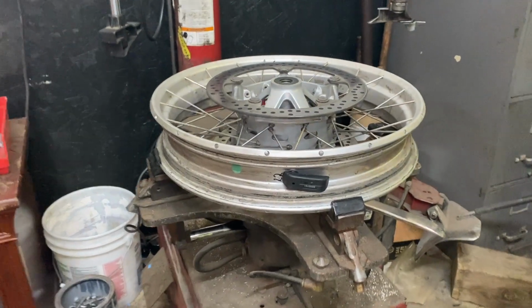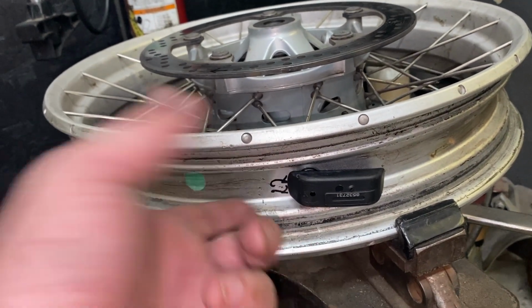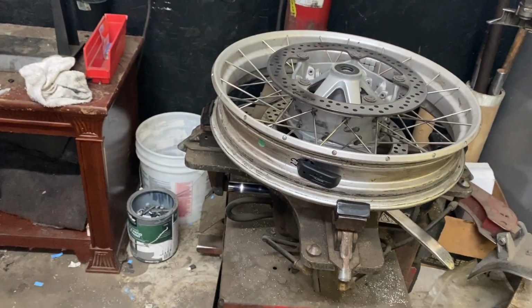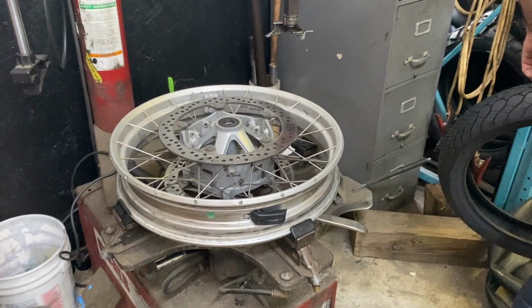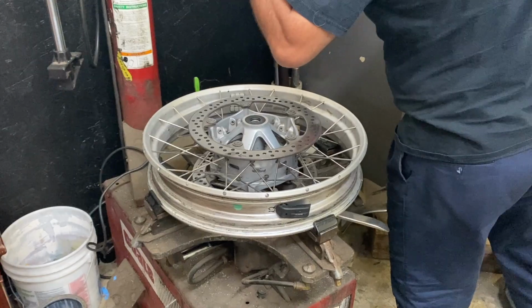So I don't know, you might not know this, but this is an aftermarket one because they failed. The bike is 7 years old. And we just got those. Are those the ones you got off eBay? I don't remember where I got them, but yeah, somewhere. And then we needed a tool to wake them up. And then we used the GS911 to key them to the computer in the bike. And they work just fine.